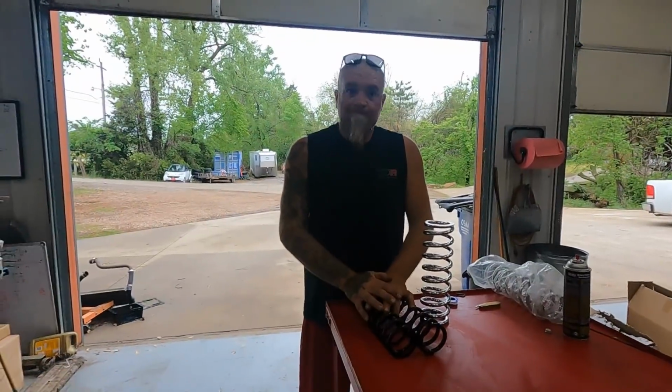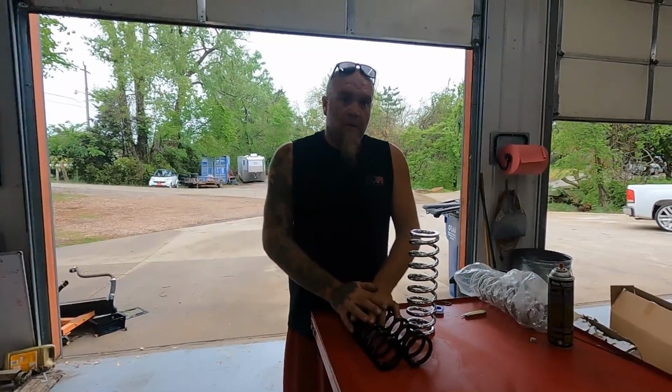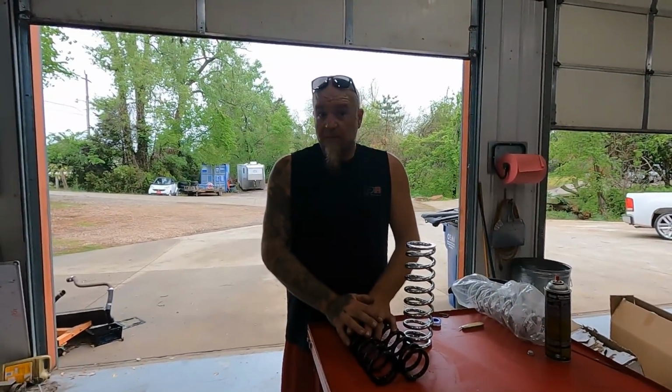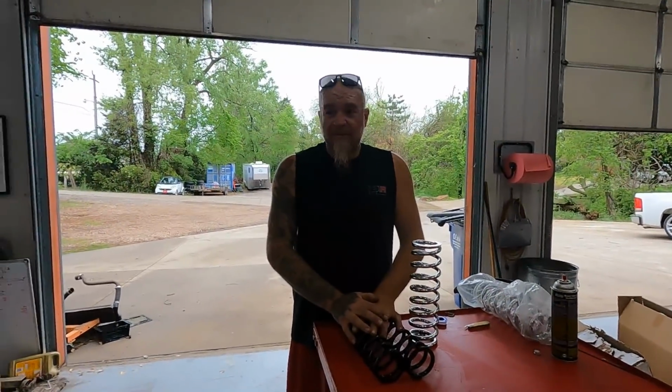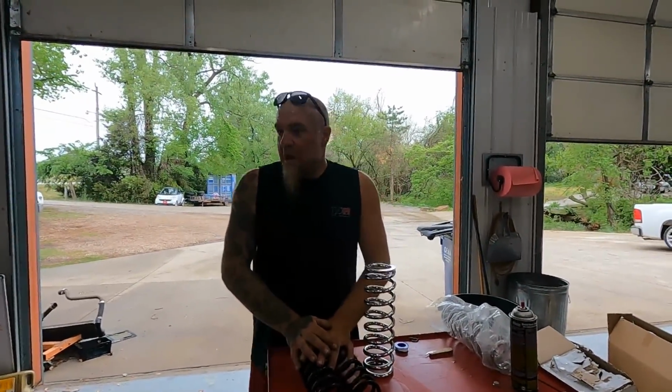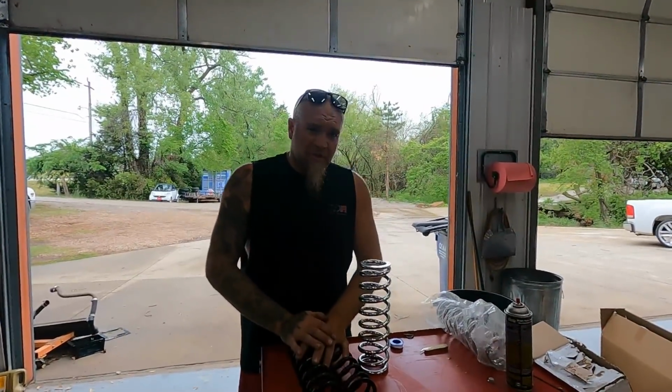So when you say 53, this thing with you in it is 3,040 pounds, and 53% of that is on the front of the car. Yes. Where do you want it? I'm not going to stop today until we're 50-50. 50% front, 50% back. Yes. It doesn't matter how much weight I have to stack in the trunk, but to get it from 53 on the nose to 50-50, I'll bet we don't have to put more than 50 pounds in the trunk.